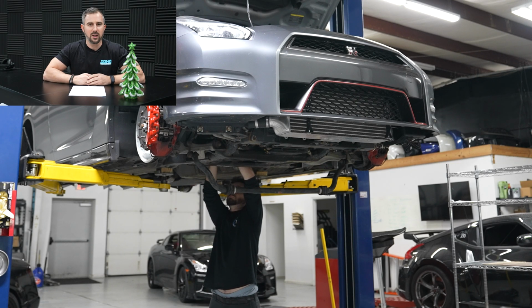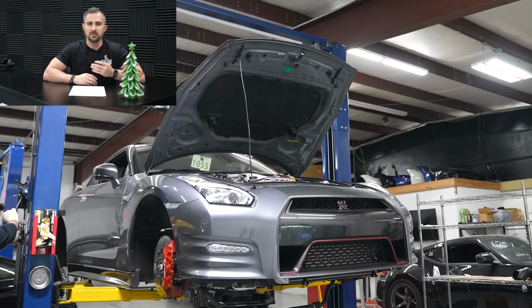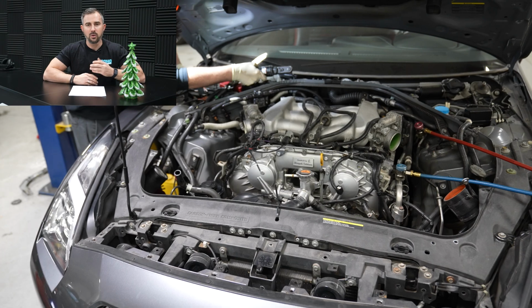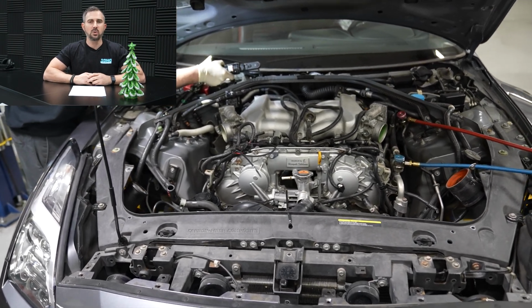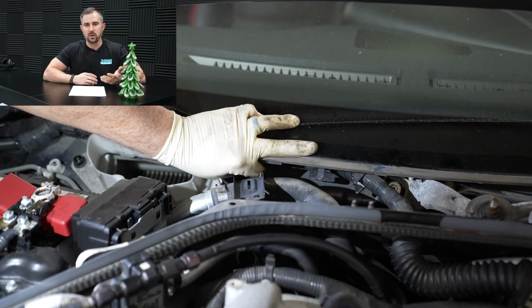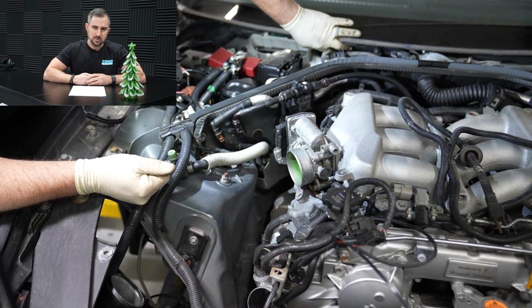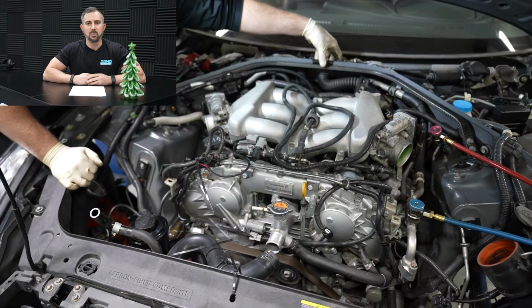The vehicle itself already had, like I said, full exhaust components on it. It had an upgraded intercooler, intakes, a speed density kit, and a flex fuel kit from Visconti. Regarding the fuel, it had upgraded Visconti twin 450 fuel pumps. With us not knowing the condition of the pumps, we replaced them as a precaution to ensure we had brand new pumps in there, because we were unsure of the life of the pumps that were in the vehicle.